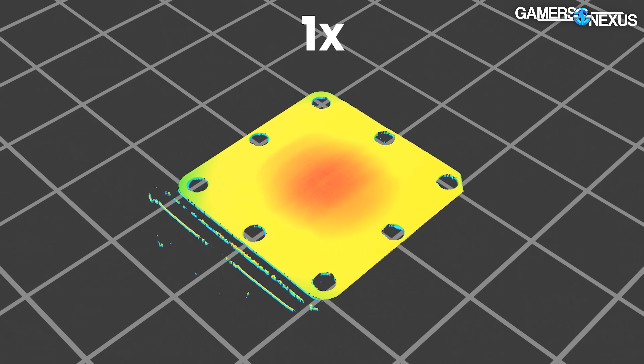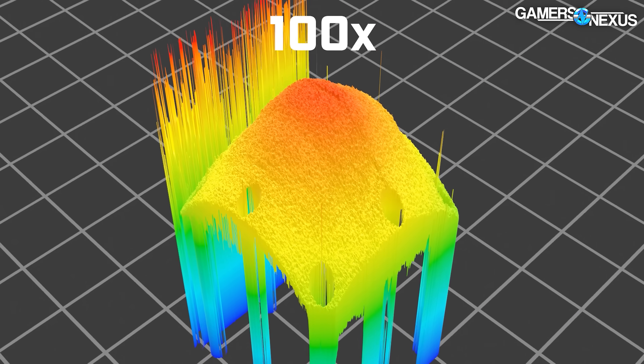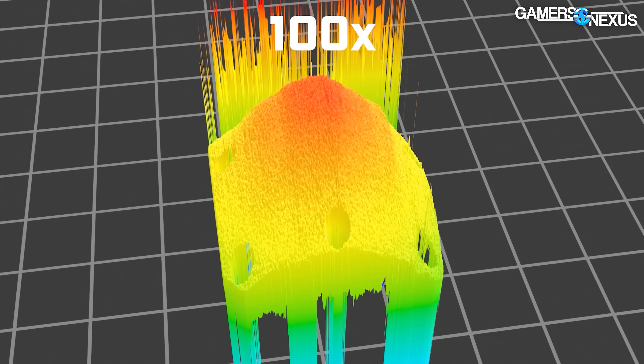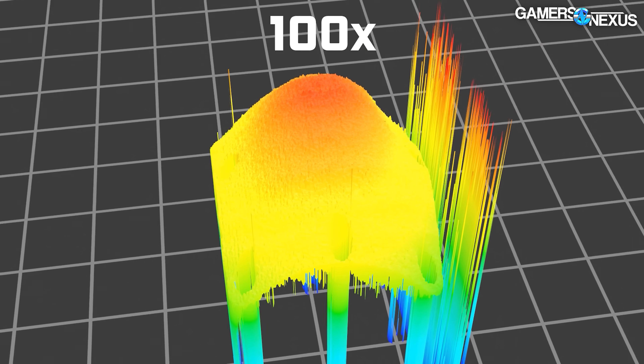Right into the cool stuff — this is our 3D laser scan. You can see that it has a heavy focus on a protruding area of the cold plate centrally towards the IHS. This should benefit its cooling by focusing contact on the area where the silicon is.